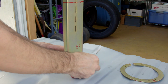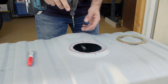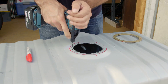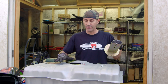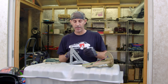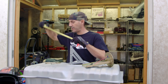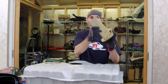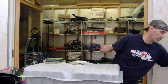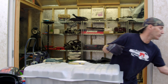Then you flip this over and use it as your hole template, and drill all of your 3/16 holes. Now that we have our holes clear and stout and everything clocked in the right direction, I went ahead and measured — I just took a square and a tape measure, and once your flange is kind of flattened out, you just measure down into the hole. That gave me a measurement of nine and three-eighths inches. I went ahead and cut the pump to that, and it sits perfectly in place just off the floor, so when you mount your pickup tray in there, it'll sit just off the floor and be able to capture enough fuel and never starve the pump.